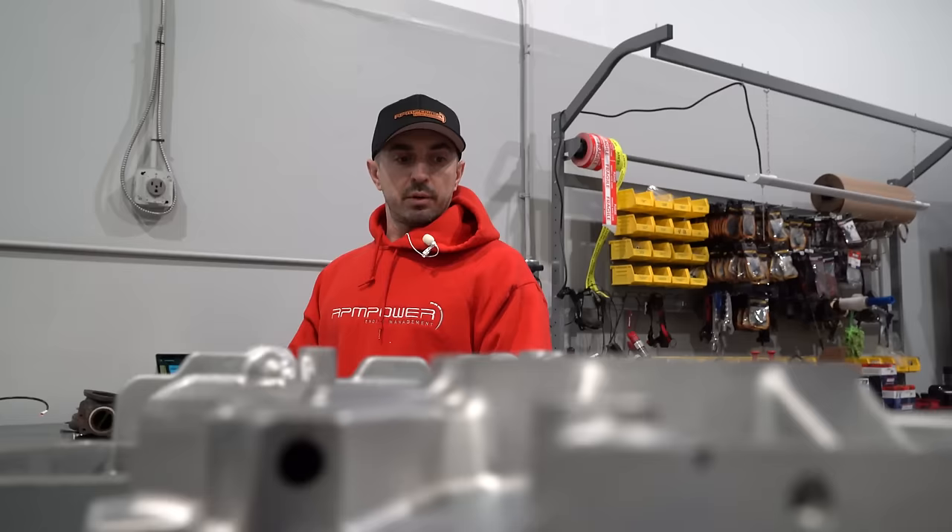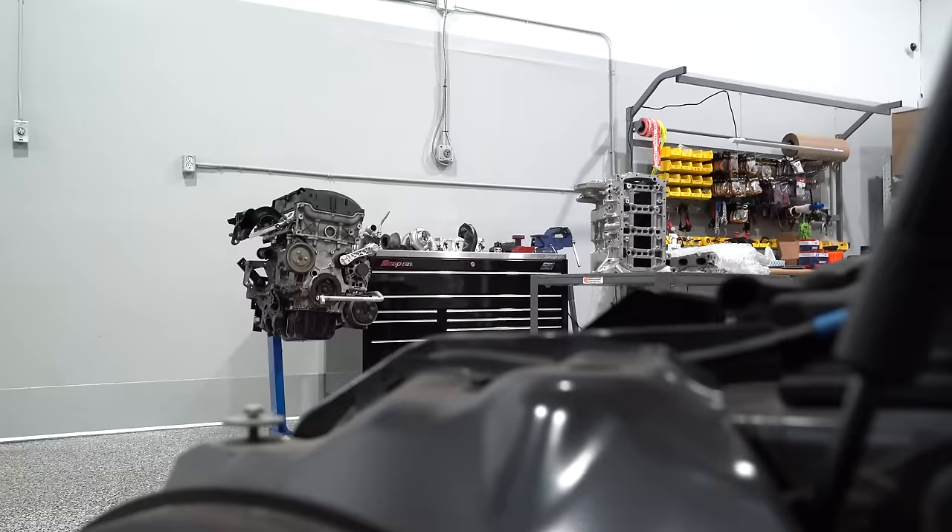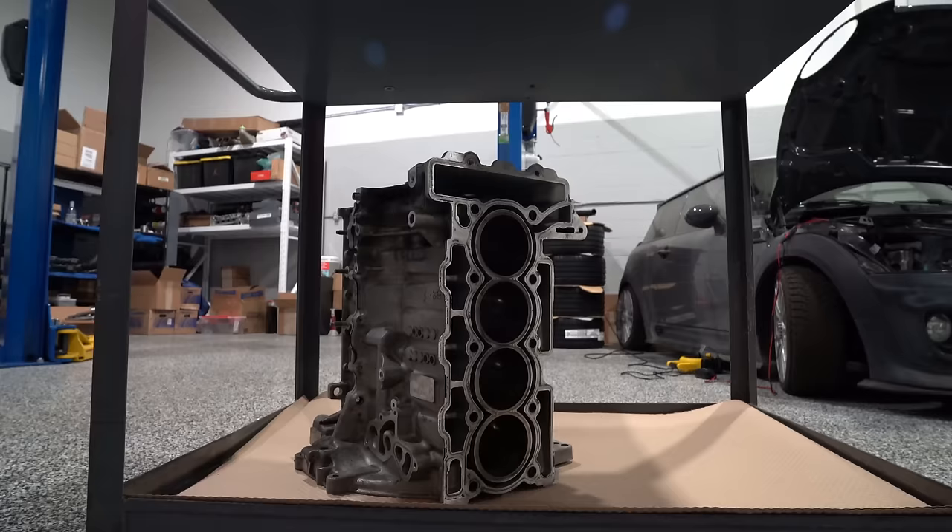There are rumors that it's got a better oil pump, but no — the oil pump is just as good as the N14, or vice versa. The only difference is they added a solenoid to calm the oil pressure down when it doesn't need to be high. What I want to highlight about the stock motor: it's a very reliable, very robust motor. The majority of things necessary to create a good reliable build are there from the factory.